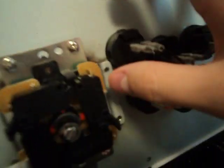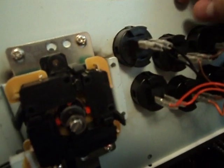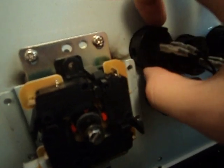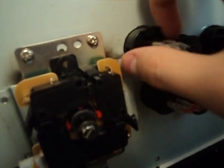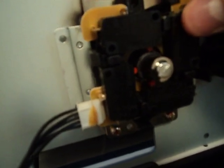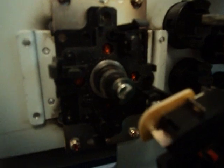The first time you do this, the buttons will be a pain to get out because they make them really hard to get out the first time. The second time you can just slide them around, whatever you need to do. And that's the PCB, and once you get the octagon gate or any gate off, you can slide that off the same, and then you just have the straight-up stick mechanism. There's no PCB, so if you just played like this, the stick wouldn't register any directions.